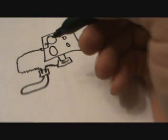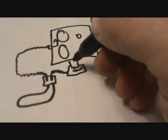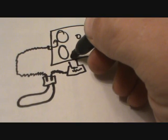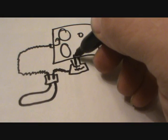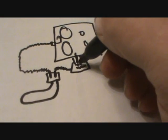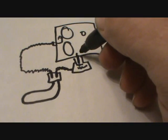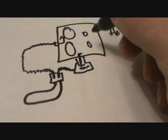These hot air choke housings, like this one and like this one, like all of them, have what's called a metered air bleed in it. It comes through the body of the carburetor back here. It's a very small, just a little drilled channel that leads into this spring chamber. And this has a vacuum signal to it because it's a vacuum bleed.